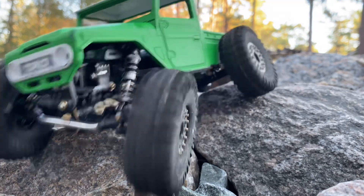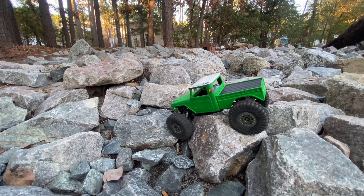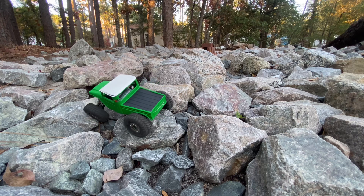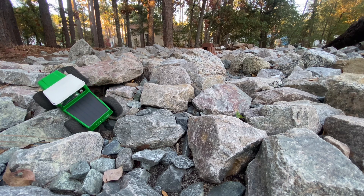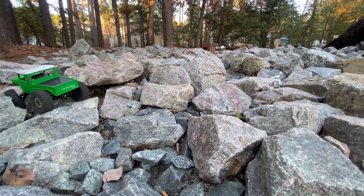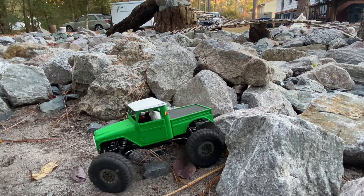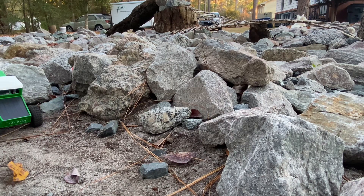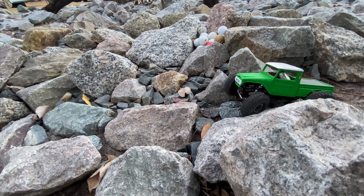Loving this rig. Once again, shout out to CCXRC for the pine trees. If you're having problems with traction and you're changing tires or you think it's your tires or whatever, and you're running a stock foam or even a foam that's a couple sizes smaller than stock, I highly recommend you spend the 20 or 25 bucks on a set of inserts if you can afford them, or if you have a 3D printer, look online and see if you can find a print pattern and get some printed up for yourself. The pine trees and the scramblers just work fantastic — you can see in a lot of these close-ups how much tire compression you get and traction forgiveness.